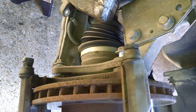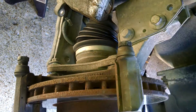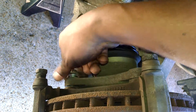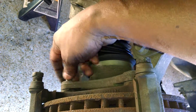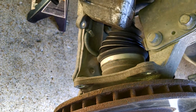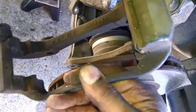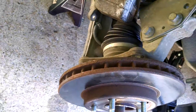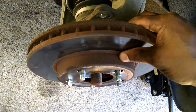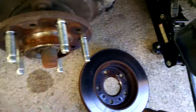I want these two 13mm bolts out right here. This is the caliper mount here — it's usually pretty simple stuff to do if you've got the tools to do it with. You can see it just fell off. This is the caliper mount — it really acts as a rotor guard too. Once that's off, we've already pre-lubed the rotor, so let's go ahead and take it off.